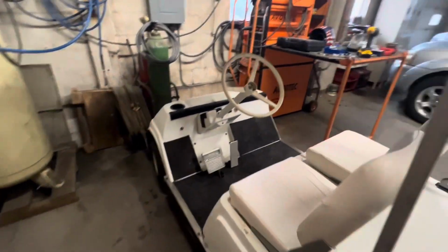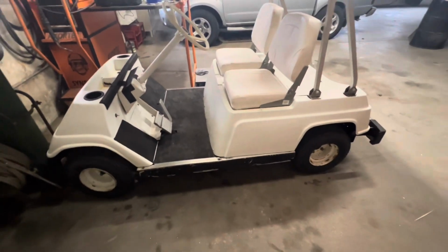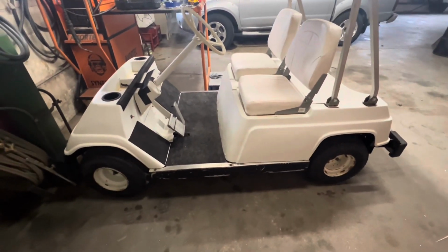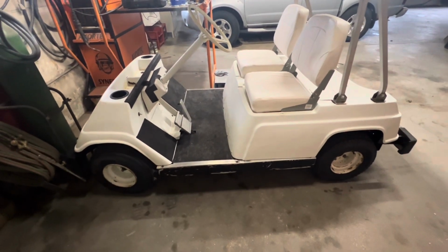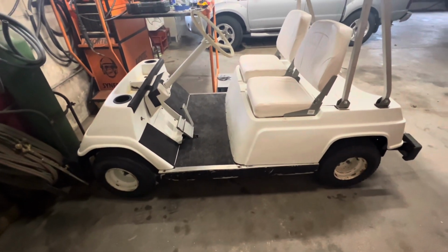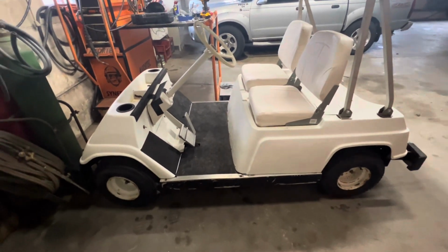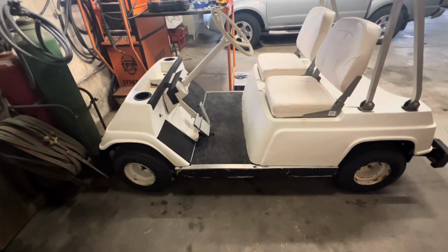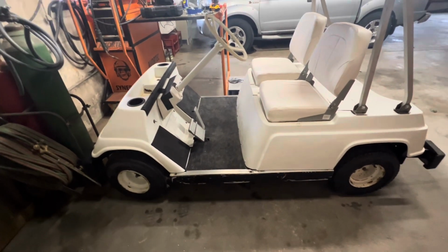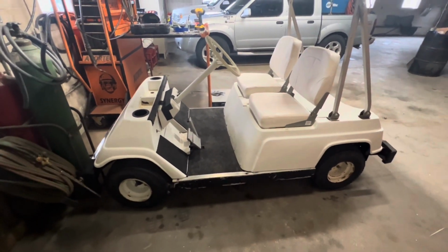It's actually, like, you can take it down the road, but it'll start dumping fuel out. So I don't know if the float level or something on that may not be quite right. It may just be leaking around a hose. I'm not 100% sure where it's leaking. But last time I took it down the road, just test driving it, that's what it did to us. So again, you shut the fuel off, run it for a minute, it'll fire back up and run. So it's flooding itself basically. So again, carb needs cleaning. It's been sitting for quite a while.